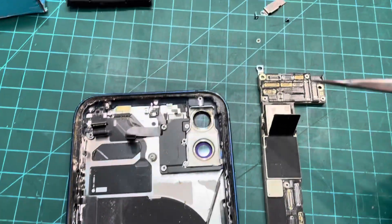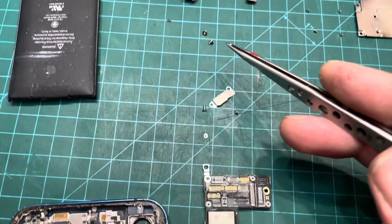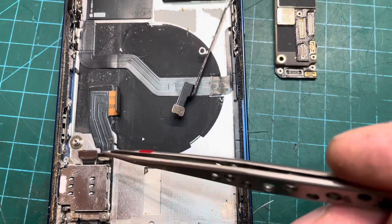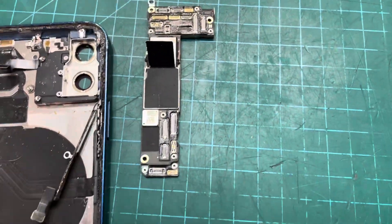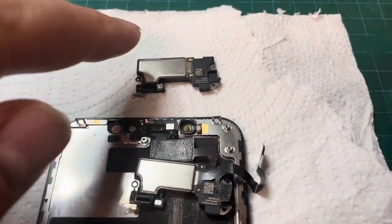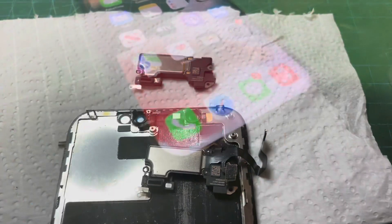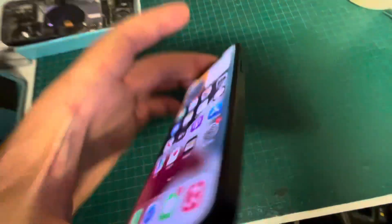That's the motherboard out - there's a cheeky little hiding screw there that was stopping me from getting it out. There's the main bolt holding the motherboard in, and then this one. And then there's another cover for the SIM tray and the dock port connector. So all of them are off. We're going to start building them into the replacement housing now. I just need to get the ear speaker replaced - that'll be these two solder joints there, that'll fall off, I'll put it onto that one.